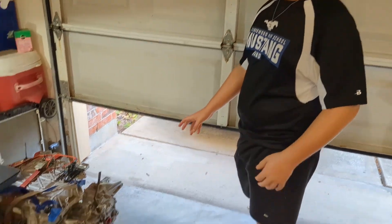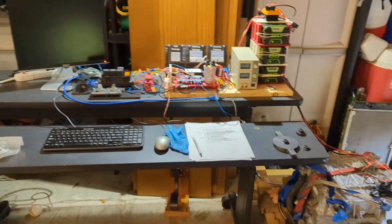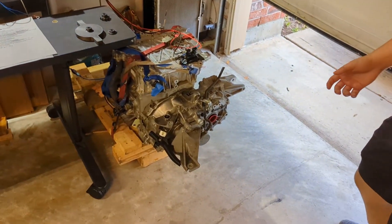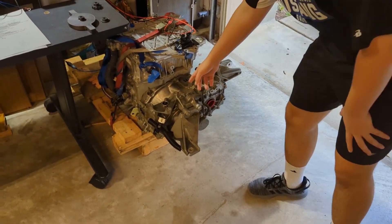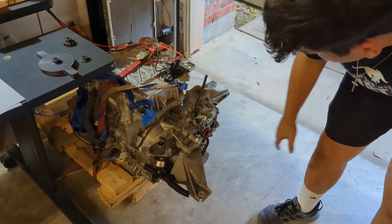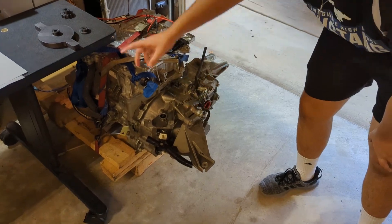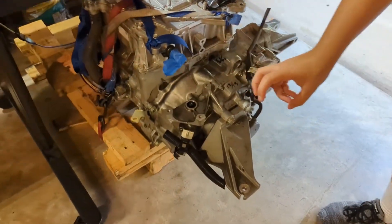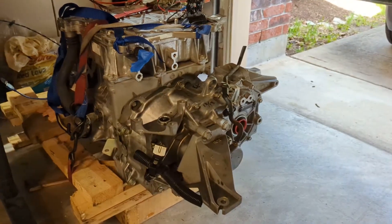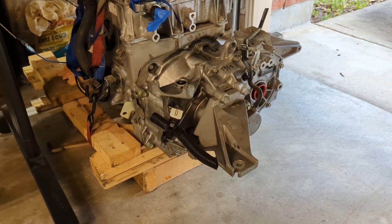The whole reason we put it on there is because we've been running tests and the motor is expecting to have some resistance or something to be pushing on, and there's nothing there — it's just the tube that comes out. So we installed the transmission, and there's this little motor which we bagged up that is right here. That's essentially the parking brake of the transmission that goes in and locks all the gears to keep it from moving.